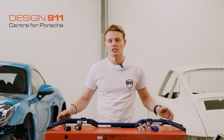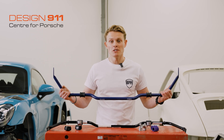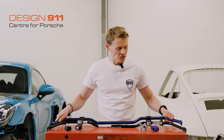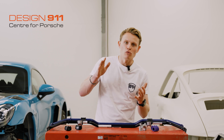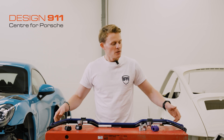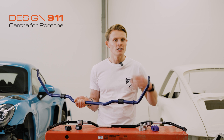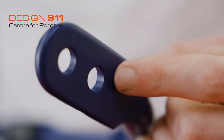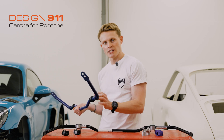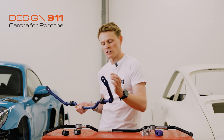Alternatively, instead of just replacing the bushings you can upgrade your entire anti-roll bar to a high-performance anti-roll bar. What makes it high performance compared to original equipment is its stiffness. This bar is a lot stiffer so it eradicates even more roll, giving you a lot more stability and feel when driving through corners. This high-performance anti-roll bar is also adjustable so you can make small tweaks to the stiffness by changing the location of your drop link. Use the first pickup hole closest to the clamps for maximum stiffness, or the second pickup hole further from the clamps to reduce stiffness slightly.